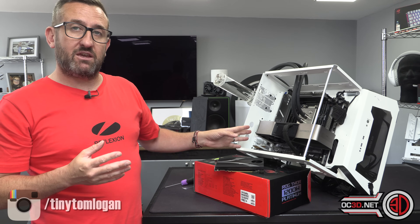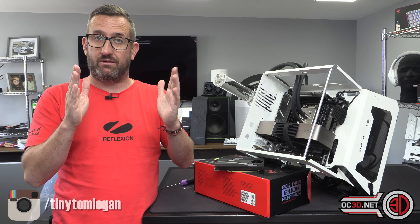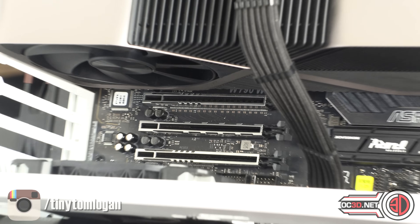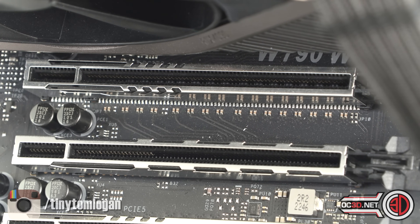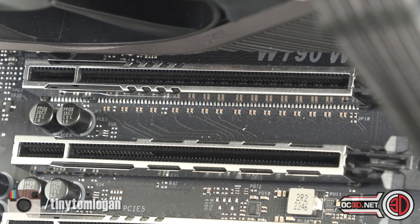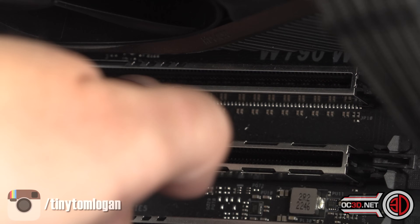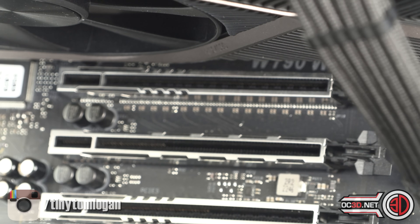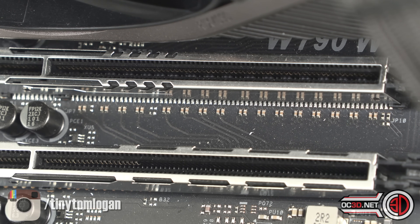If you've already got the board, some of you may get a bit confused because some PCI Express slots can be full-length but not fully wired. I've got the test bench tipped over and if we zoom in on that top visible PCI Express connector, you can see that the brass pins go right to the very edge — that is a full x16 lane.